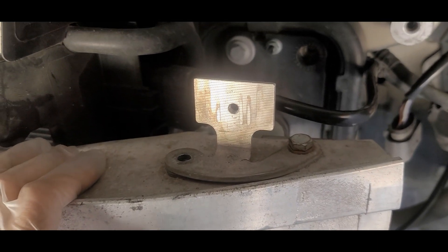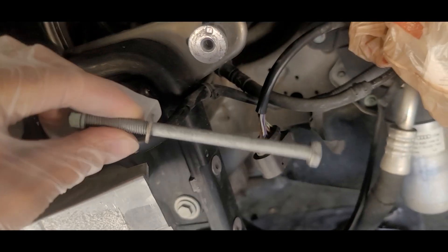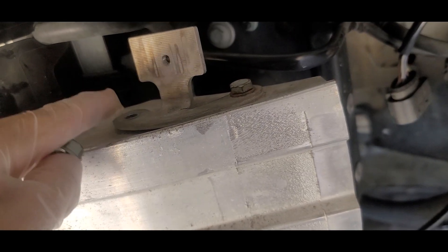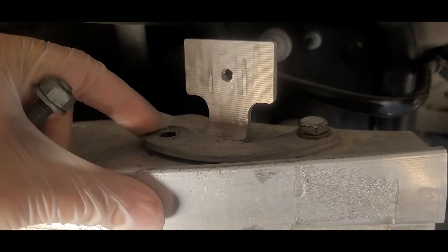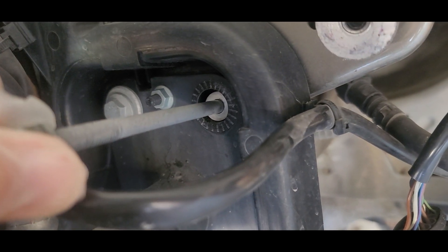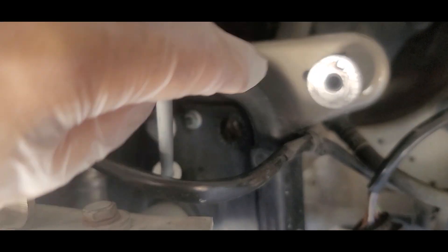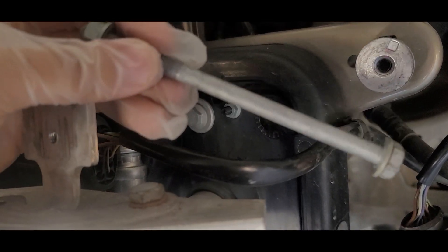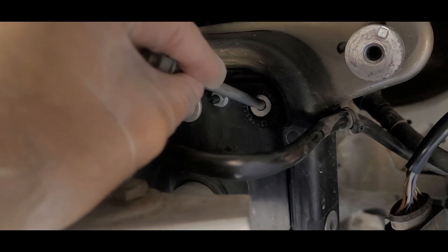I went ahead and removed one of the screws from the bumper bar — it looks like this, actually longer. You could take this one out and use it in there, but then you would have no bumper bar support. Remember, you're only putting two screws — one on this side and one on the other side — and you're putting a lot of weight on this. While these are strong at class 10.9 strength, I don't think you want to take that chance.